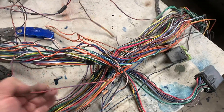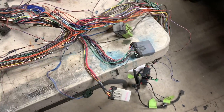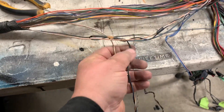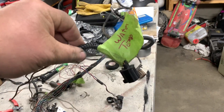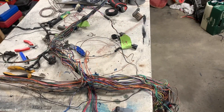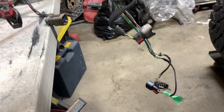This one joins into two, which connects to another O2 sensor plug. We're going to snip that one off, and then this harness will go into the main one — we're just going to snip them off right there. This one is water temperature out of that same leg, and we need to keep that one because we're going to reuse it — most likely shorten it a little bit. The next branch I'm going to remove is the fuel injection harness.